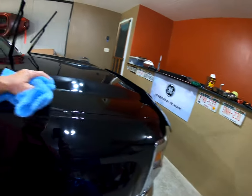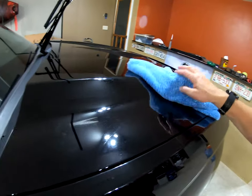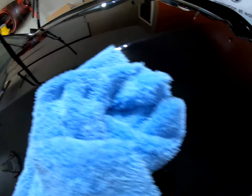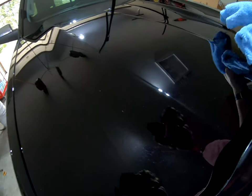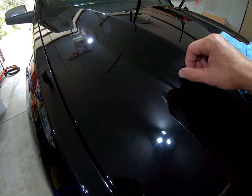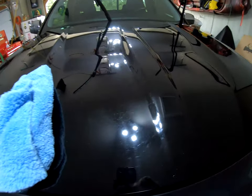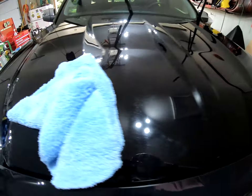Now I've clayed the hood and I'm going to break this down. I did the whole front of the vehicle, and I can tell by the way this microfiber's going across here that there's nothing left on it. I've got swirls — I don't know if you can see that — but I'm going to go through and use a Griot's product to hopefully get all that out. I know this vehicle was stuck in a hailstorm, and here are some spots that need to be repaired. It looks good, but I can just see stuff that needs to be corrected underneath. We'll get started on that.